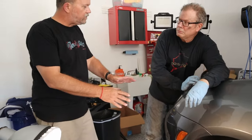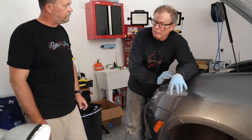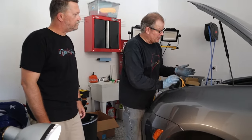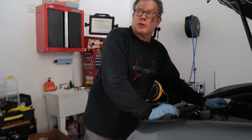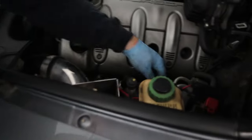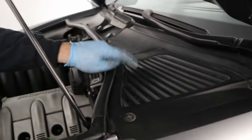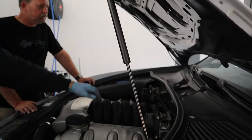We've lowered the car a little bit and loosened all these up. After loosening all the bolts and disconnecting the wires, we have to come inside the engine bay — there are three bolts to get to on each side. Two are easy. There's one here, one buried kind of in here, and one that's tough to get to. On the other side, that one's even tougher because you have to bend the panel, and these panels are getting old and brittle.